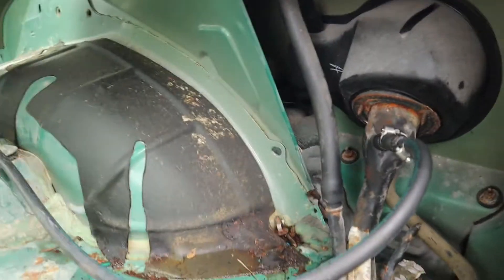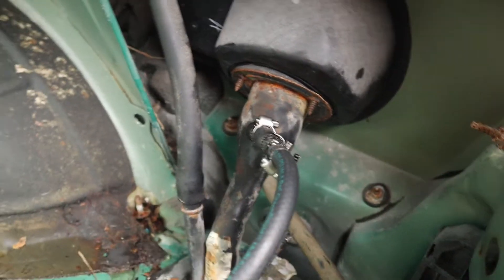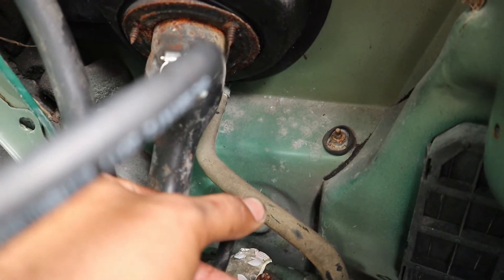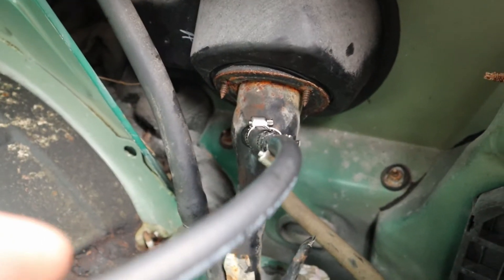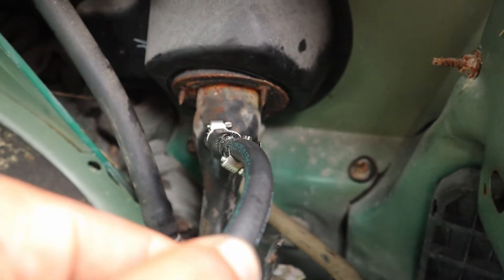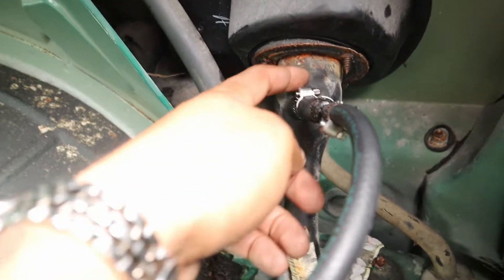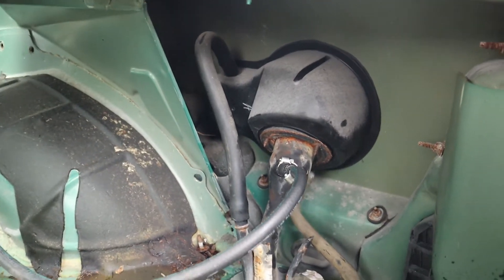This is where it got tricky. There's a fuel line that's a breather from the tank — it's disconnected underneath and no longer runs to my tank. It used to come up and go back into the filler neck. All I did was cut it, and I ran the return side for the fuel rail into the inlet side of the neck. The fuel builds to 40 PSI and the rest is spit back into the tank.